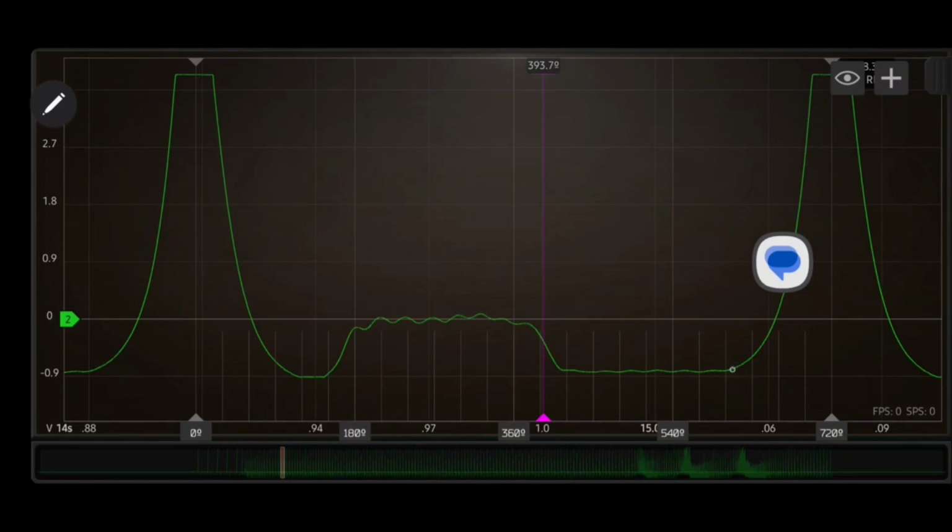So we're definitely retarded on that also. We're not off by much, but I'm going to say probably another 15 degrees or so off on that line there also. So this whole entire intake cam right here is actually retarded probably 10 to 15 degrees. And then this exhaust cam right here, let me see, if that's there, we're going that way, so we'd actually move to the right, so that's going to be retarded also. So we could say that exhaust cam is retarded too, probably 4 degrees or so.